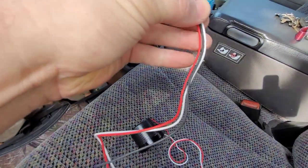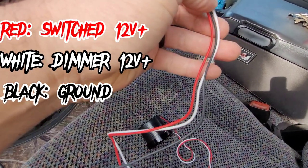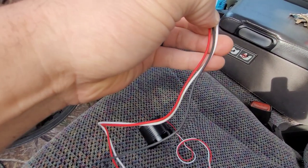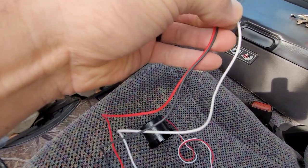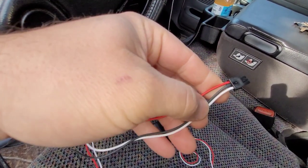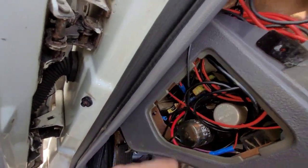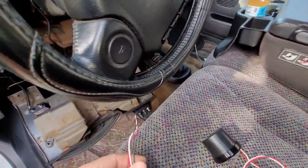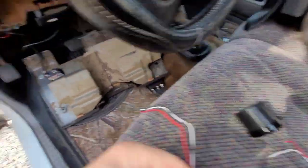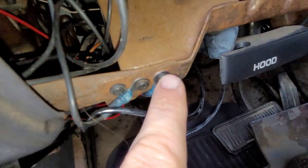Powering the gauge, you've got a three-wire connector: red is your switched voltage, ground obviously, and white if you want to power the needle as a dimmer for the backlight. It's a pretty easy switch setup. You can take the red and the white, put them together, find a fusible link, put it in your fuse panel or back under the hood, and ground it to the studs right there — it's a good grounding area.